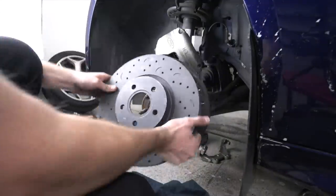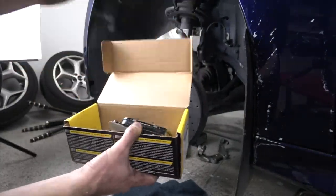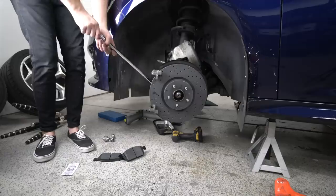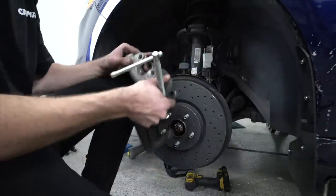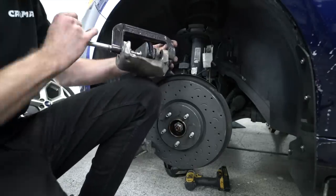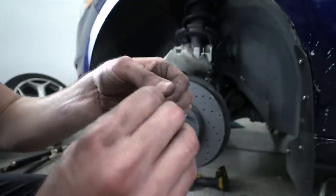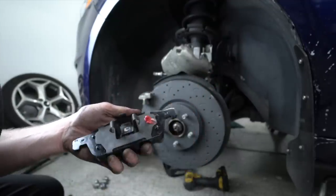Now I've got my new Hawk Performance left side brake rotor with the new pads — low dust, ceramic. I am stoked to get these on. Let's get our caliper bracket back on, zap it on with our 18mm bolts, put some torque behind it, make sure they're tight — we do not want our brakes falling off. Now let's take our C-clamp. You put a brake pad in there, do the other side. Flip it to the metal side and push that piston all the way in so the new pads can fit. We're going to take our grease pack and put it on — this is the first time I've ever used grease on my brakes.